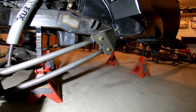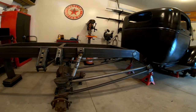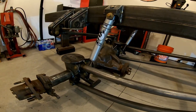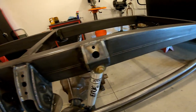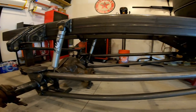For the rear axle I went with a Chevy 14-bolt — comes with 4.10 gears and a factory limited slip. Here you can see the same Fox shocks and a parallel four-link similar to the front, except I used 2-inch DOM tube for the rear four-link.